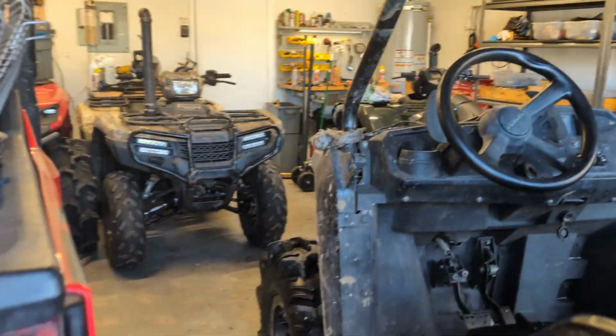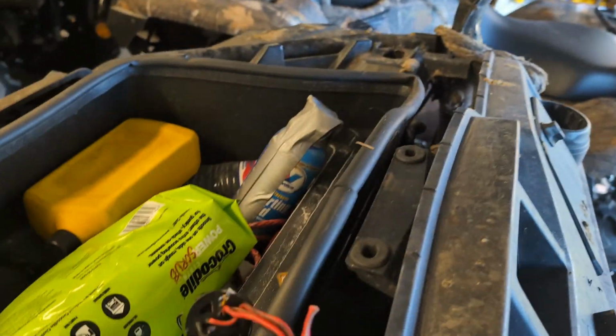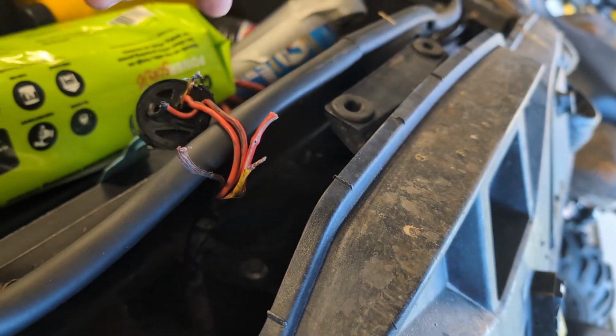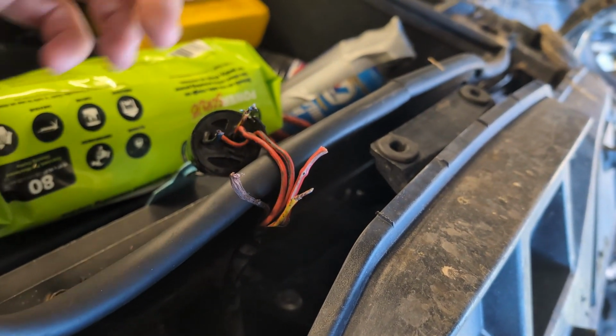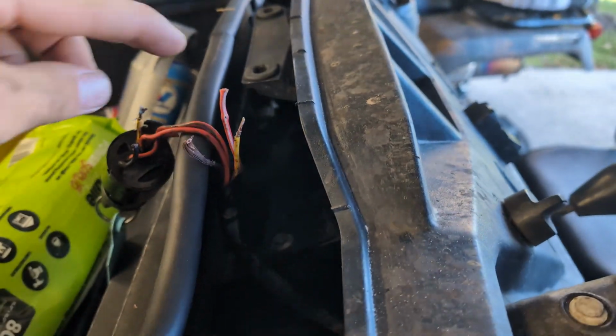And I was just thinking about it and I realized I really should have 2 of these switches. There are 2 power wires into the circuit and there's 2 power wires out of the circuit. So they probably have them separated in the switch. And they do that for fusing reasons, not overloading wires. I'm gonna wire them all up to one switch.